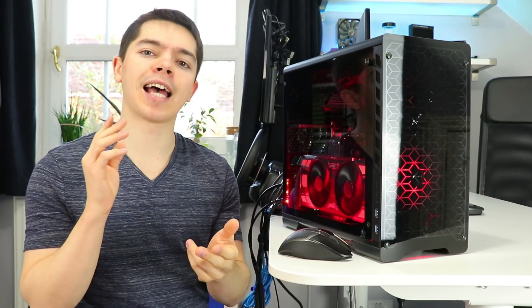One thing worth going over regarding the testing: it's very difficult to get a perfect setup that will make everyone happy. Some people like only running their fans at 20 or 30% on the PWM curve — basically as slow as you can go — and anything louder irritates them. Some people will hate a system going over 60 degrees and will put everything in to keep it as low as possible. From my perspective, running at full fan speed means there are no fan curve variables, though managing software and accounting for different loads does get complicated.